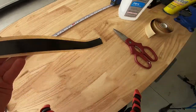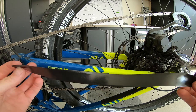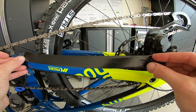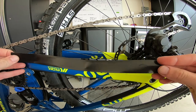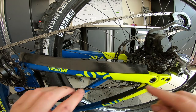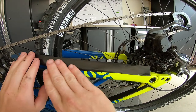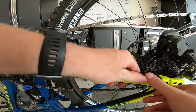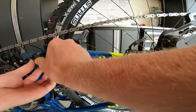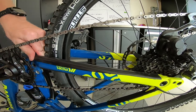I got this piece cut, I'm gonna go back over to the bike. Installing this is super easy — basically just peel and then you're left with this rubbery substance here. We're gonna go like this, try to cover all of the marks that were there before, make sure it's gonna line up good. Get it right on the edge and then kind of push it down flush. Make sure all the edges are pushed down, and if you spend a little time getting it warm with your hands by rubbing on it, it will stick a lot better. Or if you have a blow dryer or a heat gun, you can blow dry on that and it'll definitely get to stick really well.